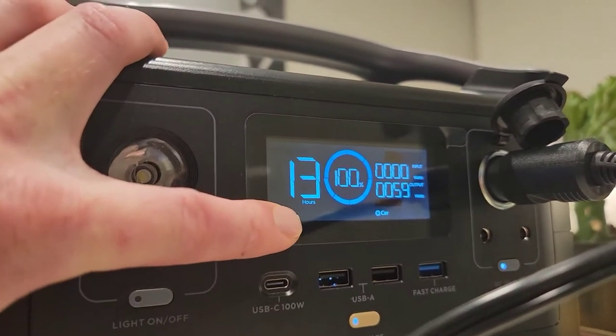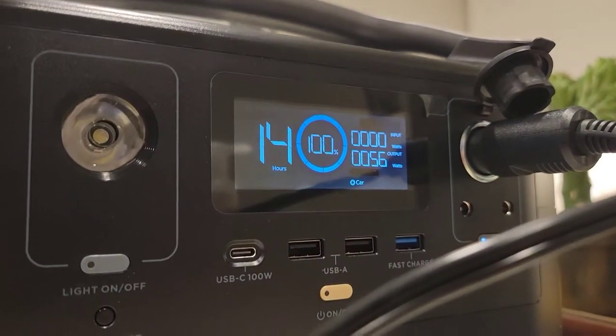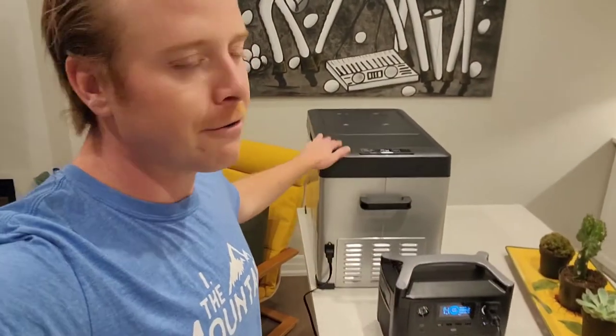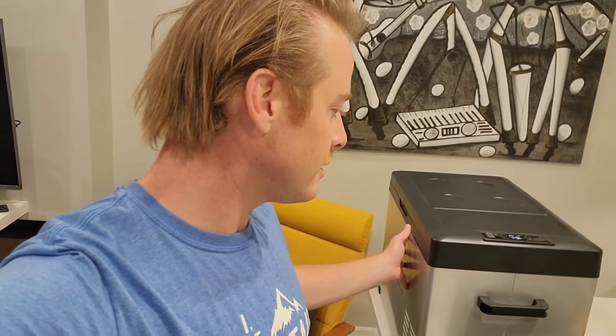The EcoFlow does a really good job of estimating how many hours something will run for — when I was charging it, it told me there was 17 minutes till fully charged, which is pretty cool. One thing to note about the fridge only being able to power it for 13 to 14 hours as shown here: fridges run, get to their set temperature, and then stop. If it's hotter out, the fridge will keep having to kick back on because the insulation can't keep up as long. But in temperatures like this condo, it'll cycle up a degree or two and kick back on. So it doesn't mean the fridge will only last 13 hours — the compressor runtime will be 13 hours, depending on temperature.